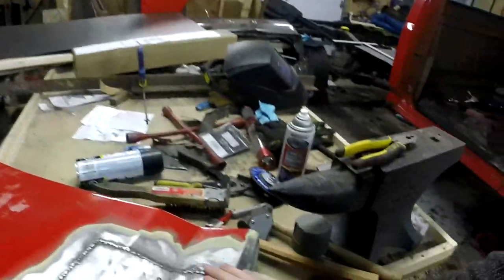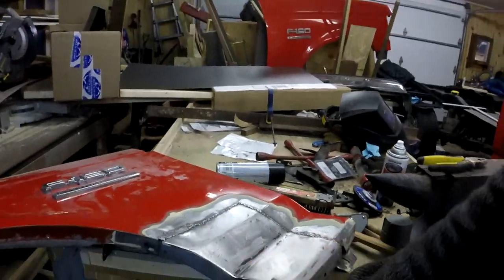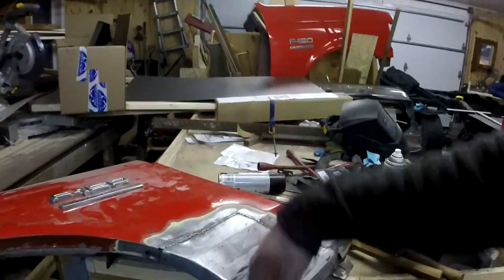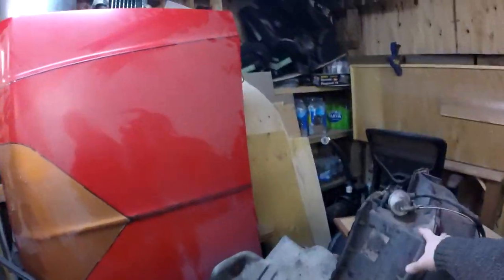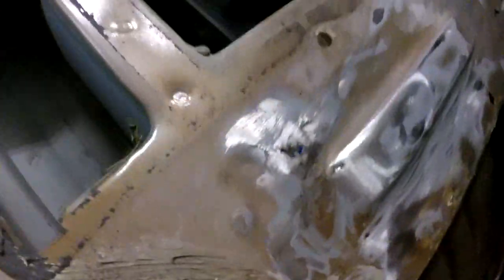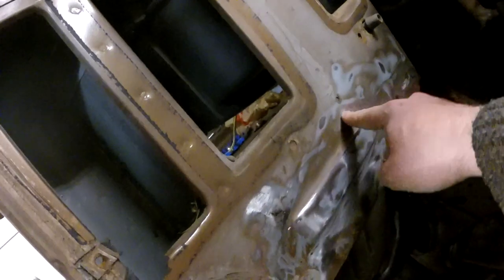Got some nice progress on the fender. The first fender is done. Of course there'll be putty. This is ground down pretty well - I don't want to go too far because I know my welds suck; they're brittle and don't penetrate very well, so I just wanted something to work. Moving on to the next part - looking more thoroughly I found quite a bit of painted rust in the corner, which led me to completely remove the ventilation heater system. That exposed all this, and once I ground here you can actually see right through this section, so I'm going to have to replace basically everything here.